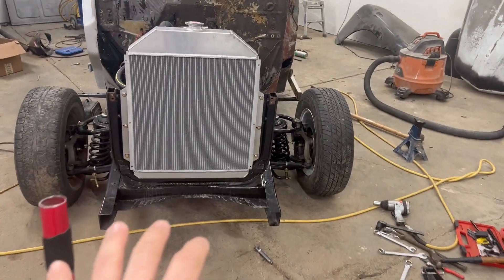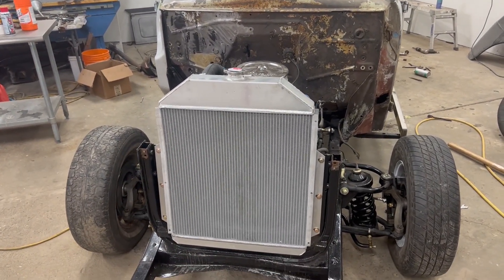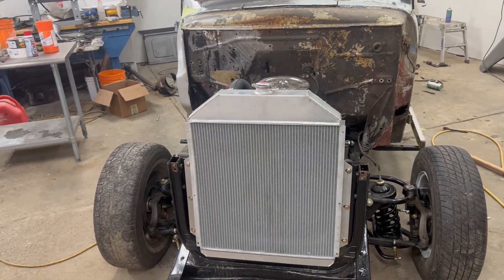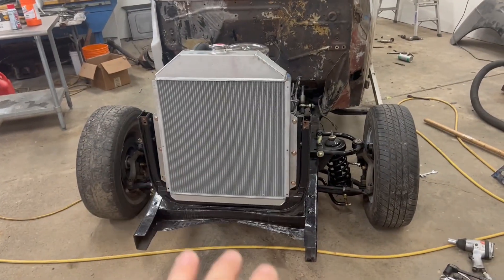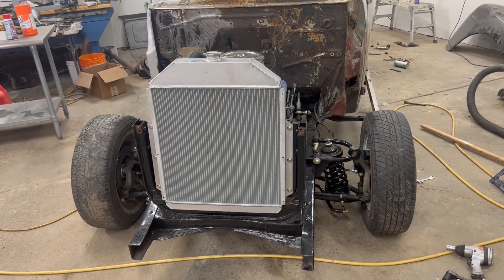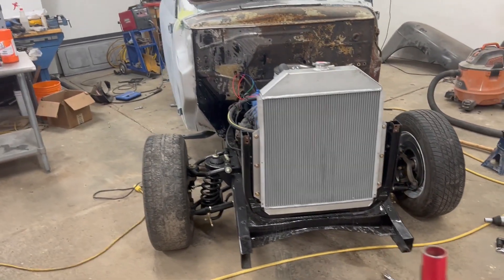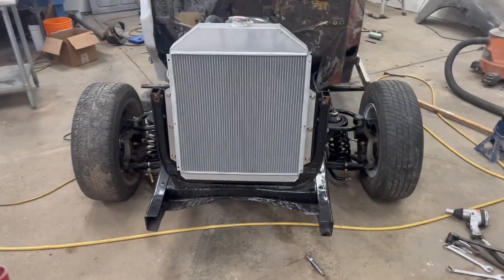So if you plan on buying this kit, I can't recommend it. There are other kits in the same price range from other companies. This company is not going to help you out and the quality of the parts does not seem very good. But if you really insist on buying this kit, you're going to have to cut some of the spring before you put it together, or you're going to end up with damaged ball joints.